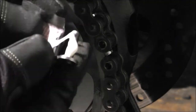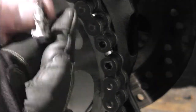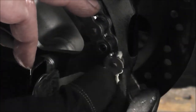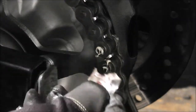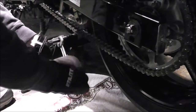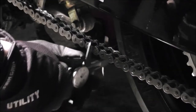This will be the first bike I've ever put a taller gear on, meaning that when I get on the highway it's going to tack a lot less RPMs than it used to - about two to three percent lower than what it would tack normally. I've always put a shorter gear in them before so I could take off quick and have a lot of torque, but I guess that's a sign I'm getting older.